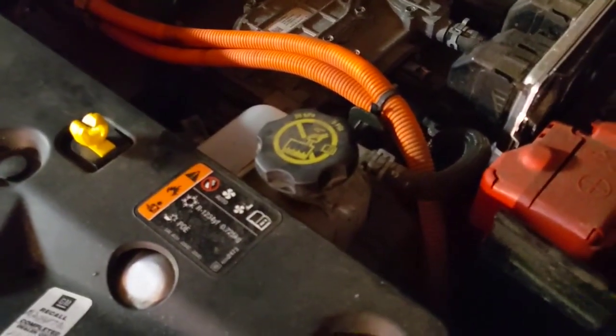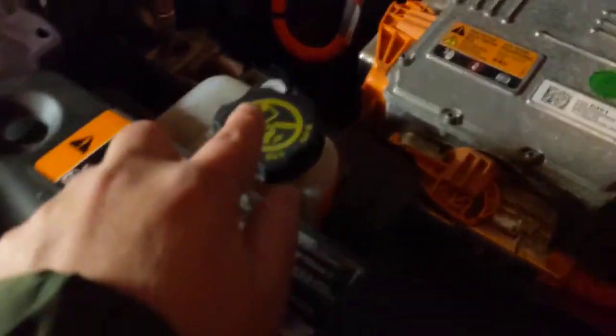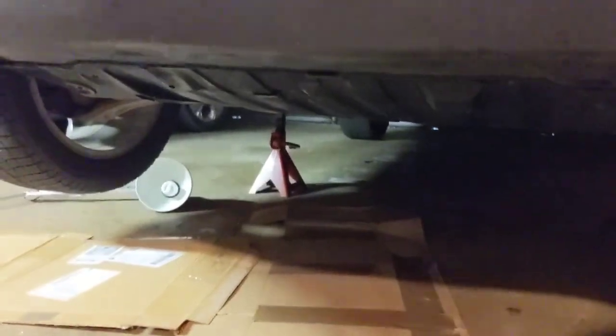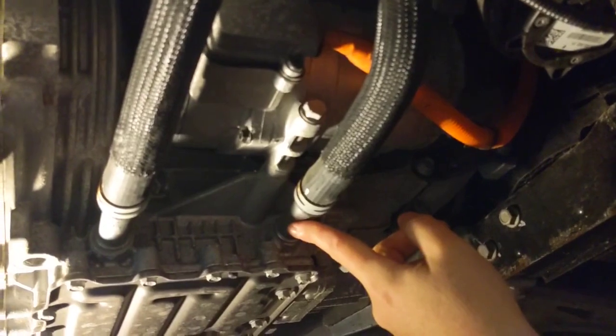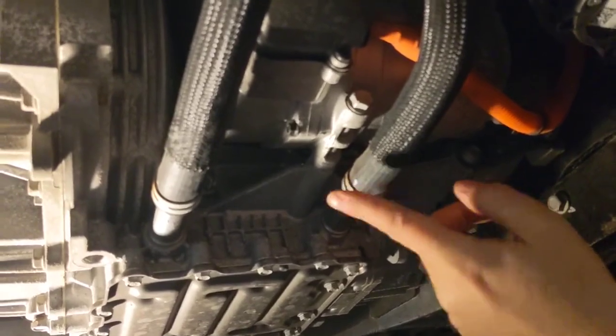First, I'm going to open the cap off the first reservoir, which is for the powertrain liquid. I'll eventually open this one as well, which is the reservoir surge tank for the battery. Next, I'm going to remove the screws for the bottom cover and detach the hoses. The cover is now lowered, and this is the pipe that will now be detached — this is the outgoing coolant from the motor — and it's starting to gush, so I have to prepare my collection vessel.